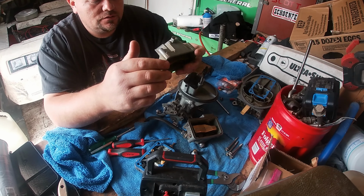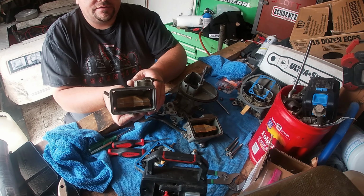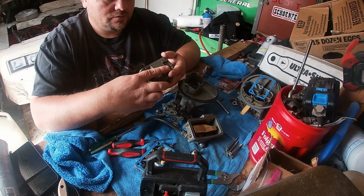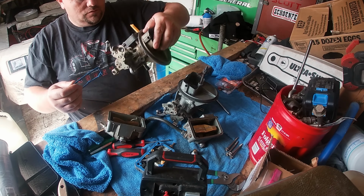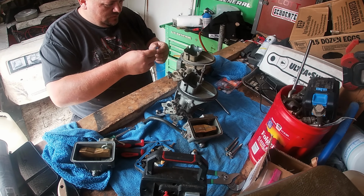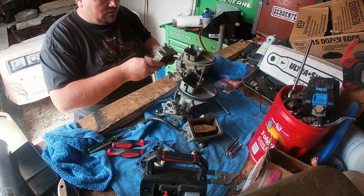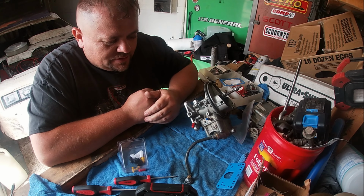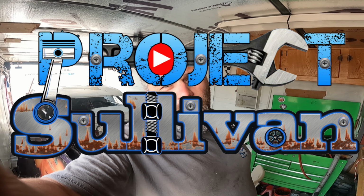I'm gonna guess that's probably pretty close. That definitely looks better for that other carburetor. So if we need it this next weekend or in the future, we can at least adjust it from there and go from there. So let's put this back on there before we lose any parts. Now if I gotta run this one, I'll feel a little better that we could adjust it right there on the track and I have no problems. There we go, it's ready to go. We'll see what happens. We did put the new power valve, cleaned it out, left the same jets, see what happens. May 20th here at Bottle Speedway.